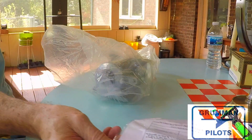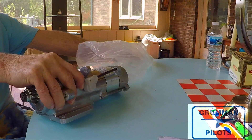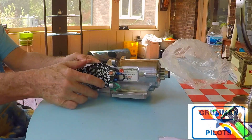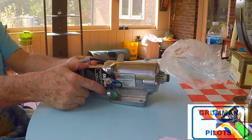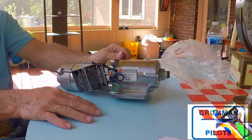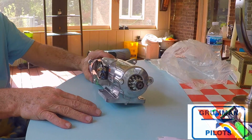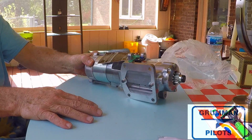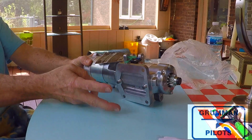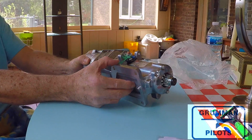Here's the nice shiny starter — it's a lightweight rare earth metal design that turns the engine a little faster. The gear head is set up for the 149-tooth ring gear found on the O-320s and O-360s. Note that the O-235s have a 122-tooth ring gear, so make sure when ordering a starter you're ordering for the correct ring gear. All the hardware is weather encased; it just needs the main battery cable attached and it's ready to go.